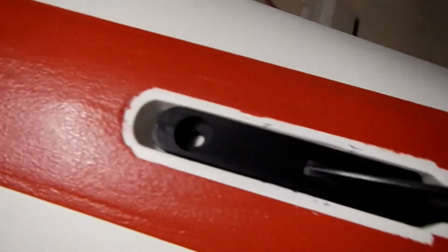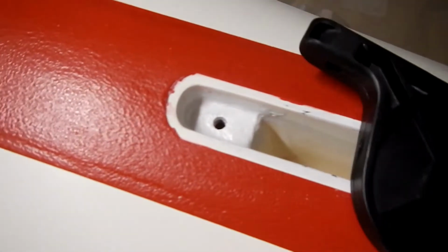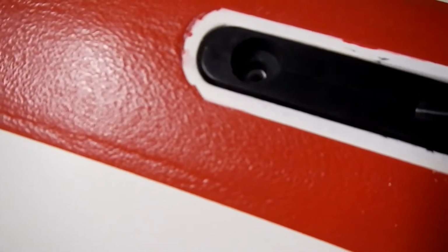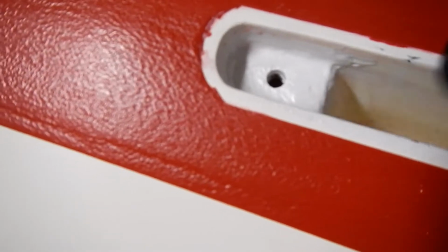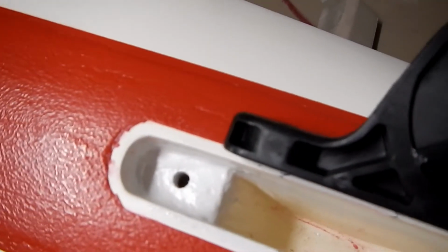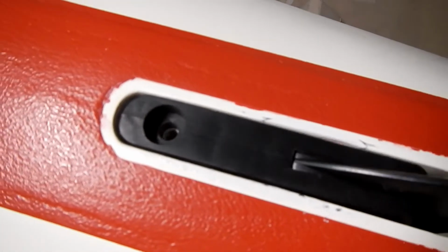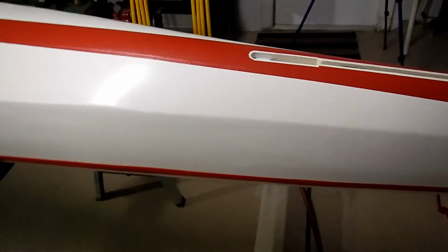But when I set this in and I push this back until this point here rides up right there, that's where it touches, and I don't know if you can tell, you see how much the screw hole's out of line? When I push it, so there's where the screw hole should be, there's where the screw hole is, so when I'm pushing it, it's literally pushing this up, so when I go to screw it down, it's going to want to cock it. So I'm going to come in, I'm going to grind some of that edge right there out, and I may end up having to just grind a little off the back of this so that that mounts in there flat without that weirdness. Kind of stupid, but whatever. I think people would have their shit together a little better.